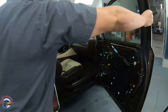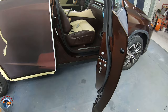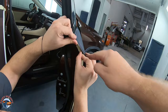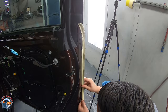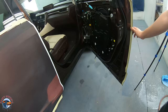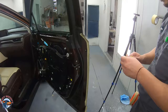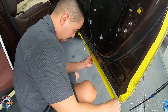On the inside of this door, pop the tape in there and then tape the inside — we want a nice gap, a nice seal between the two. Just run it right at the edge, all the way down. You can run a thicker one too — you don't need to, but it's going to help make sure there's no overspray seeping through the gap. He's running that tape on the bottom side as well.